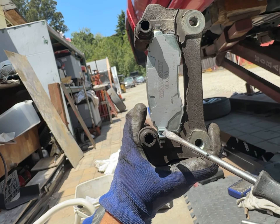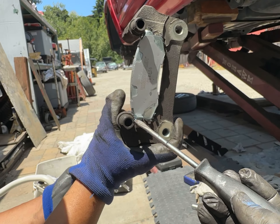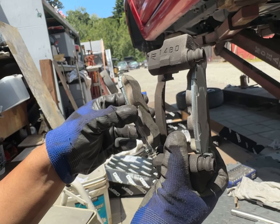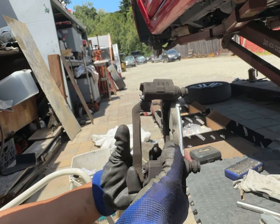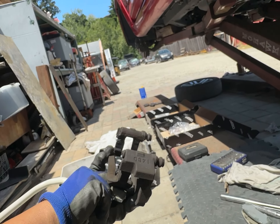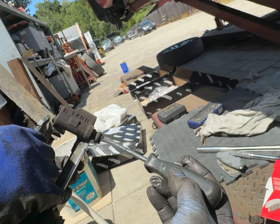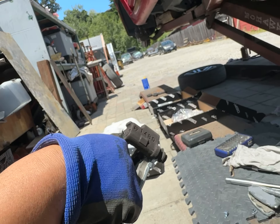So this is the bottom right here — the bottom. We put a wear indicator there, and then now we're going to put another wear indicator on the opposite side, on the inside, because they gave us four. Then after our friend does that, we're going to put some caliper grease into this hole there, so the pins can ride in there with nice grease.